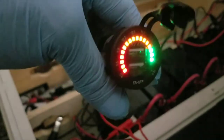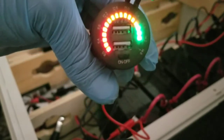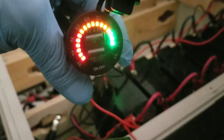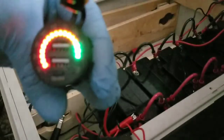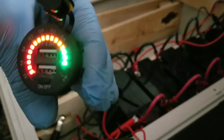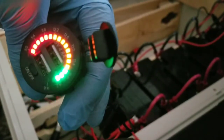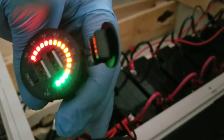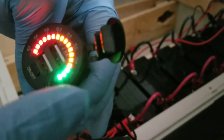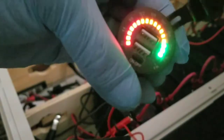You can see that now because it's putting more power, more volts into the battery. You can see the blinking LED light there. It's not 14.6 yet — we are at 14.2. So 14.2 on the meter — it's charging. That's how it's supposed to be, on the green, meaning the battery is well charged.